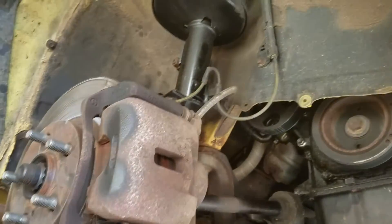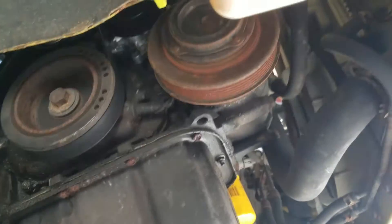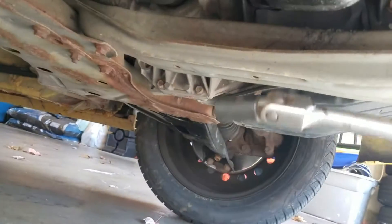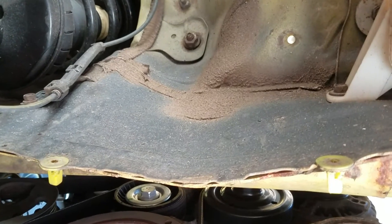What I'm having to do is remove the tire and the shield that goes over here and wraps back up around this front piece. There are two 10-millimeter bolts there and a couple underneath — on mine it was a couple of zip ties. Looking up under here, I've got one of the bolts removed. There's another one right there, and I've got my breaker bar socketed on the end. It wiggles on top so I can get it right into position and get to it pretty easily from below.